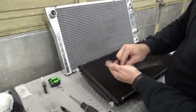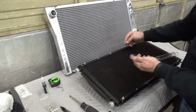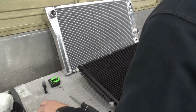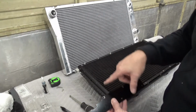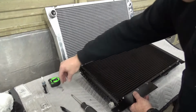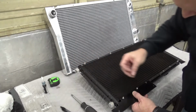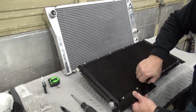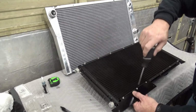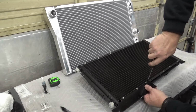We might as well drop them on the front, or the top side, just because we're there. Okay, this double-stepped one here, it needs to go on there to clear the area for the fitting to attach. Then we can use our 8-32 by 3/4 screws here. And again, I'm using all stainless steel fasteners. They're not that much more than regular steel, but I just like the increased corrosion resistance there.